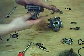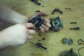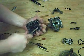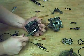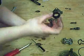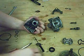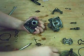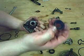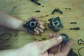Place your hand over the inside of the pump and turn it over. This will secure the vanes and keep them from falling out. Using a flat screwdriver, remove the outer wiper seal. Note the orientation of the wiper seal. The lip side of the wiper seal goes inwards towards the pressure. The flat side of the wiper seal goes out towards the pulley.